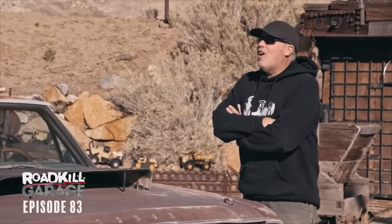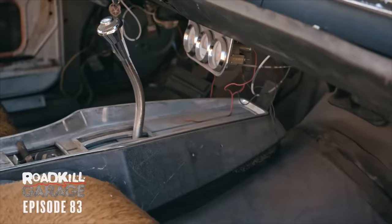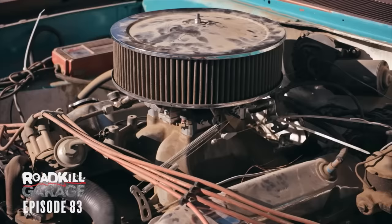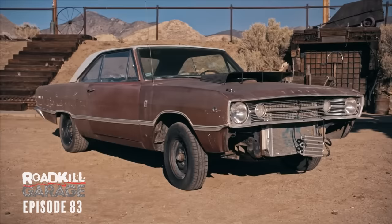This was a pure nostalgia play. Here's the skinny: it's got a swapped-in 440 big block, a 727 automatic, and an eight-and-three-quarter rear end reported to have 4.56 gears. It seems to run pretty good. It's got a Mopar M1 single-plane intake, aftermarket carburetor, air cleaner, MSD ignition. I'm pretty sure the charging system doesn't work, the exhaust has been cut off, and it probably overheats on the highway, especially with those gears.